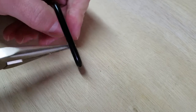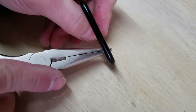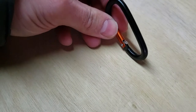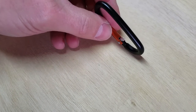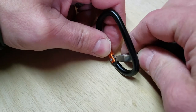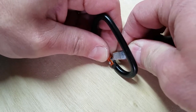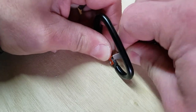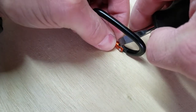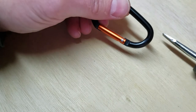Make sure the gate's on this side. You can kind of twist it just a little bit so it has a little more space to go in. You can see how far I've got it in right there — the heavier part is already up in there. We're going to work it in more, shove it up in there, and that skinnier end will actually just slide up into the right spot. I've got a smaller screwdriver here to help. Once you get it up in there, you're just shoving it up in and pushing it down onto that ledge, just like before. If you're not all the way on that ledge, it'll slip out again.